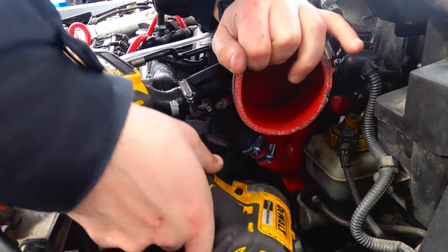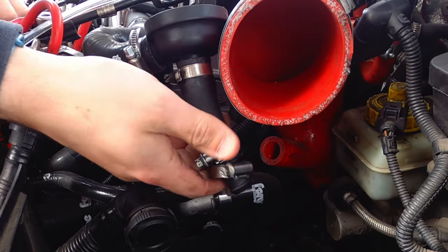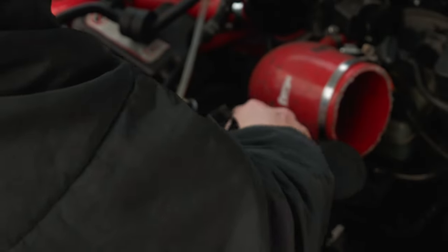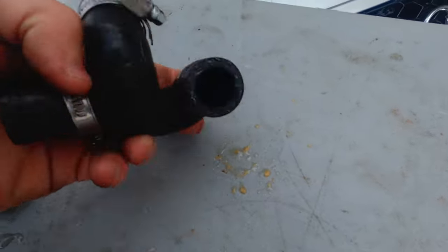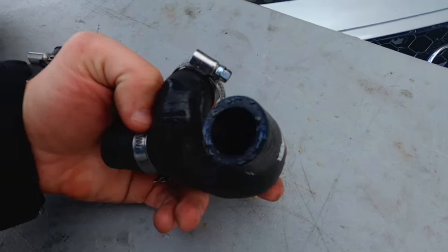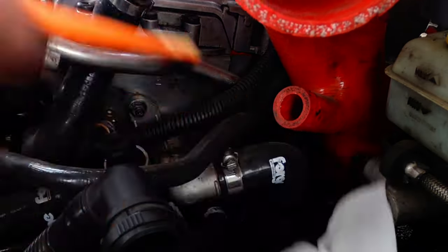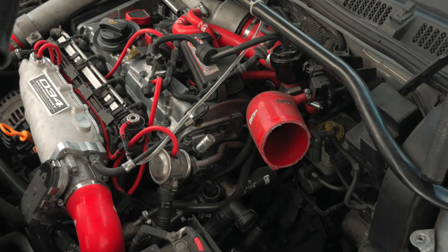As you see me take this off, look at how much water drains out of that — that is going directly into the turbo, and it is precisely what we don't want. It's also a good sign that putting a catch can right here might actually do something. This pancake valve was completely filled with grime, and consequently this hose was full of water and oily sludge — and that also means so was the turbo inlet pipe. Even the PCV is missing a lot of stuff. For the time being, I did my best to scrape it out.